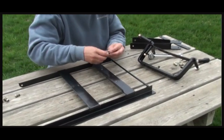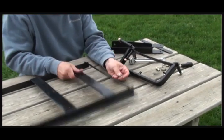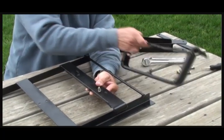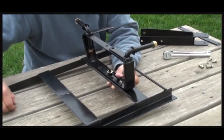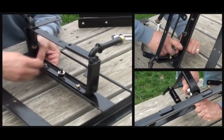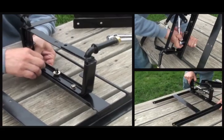First, attach the front axle to the frame. Position the frame on a flat surface, insert a flathead fastener up through the mounting hole, and place steering axle assembly onto the frame. Install the washer and lock nut and secure axle to the frame using a wrench and a screwdriver or ratchet and socket. Repeat for the remaining axle bolt.